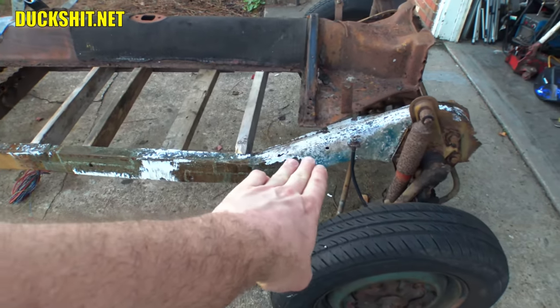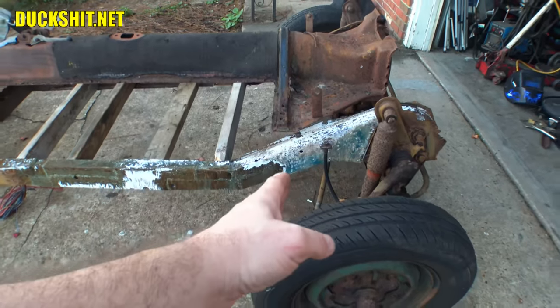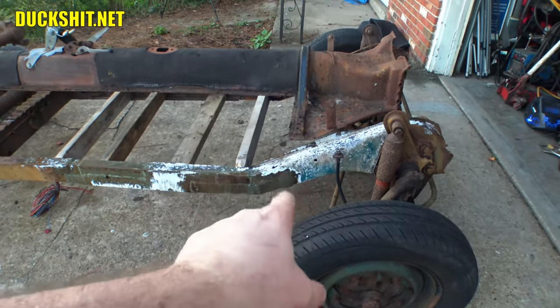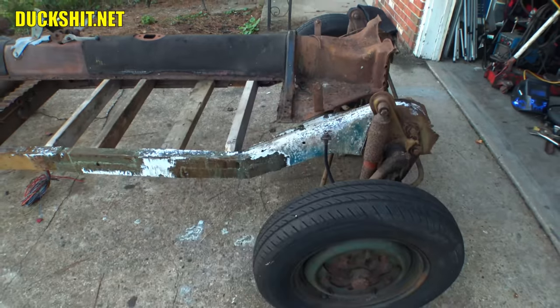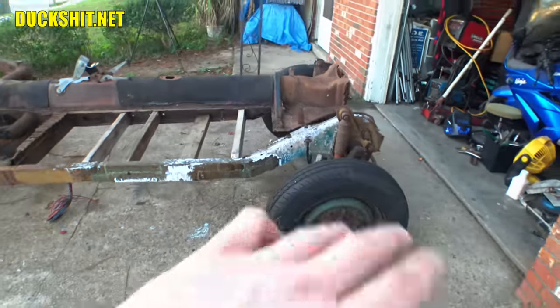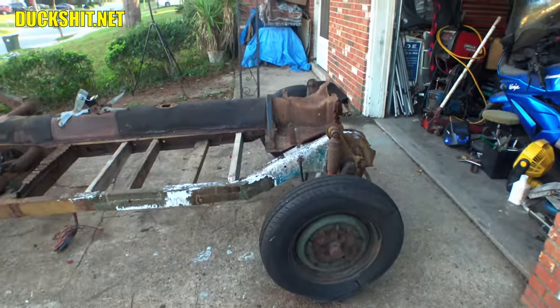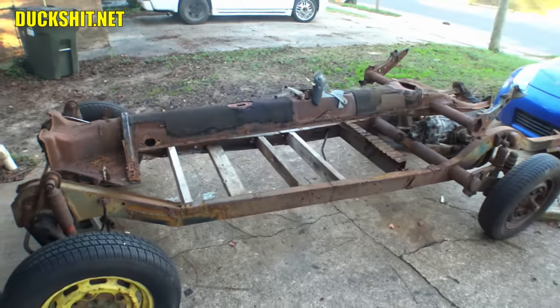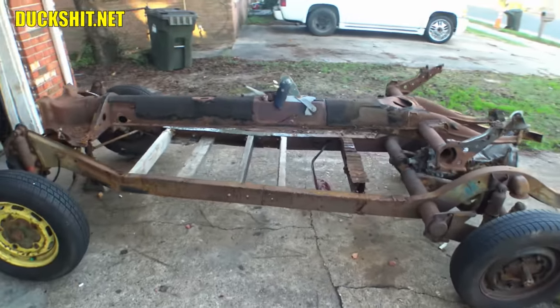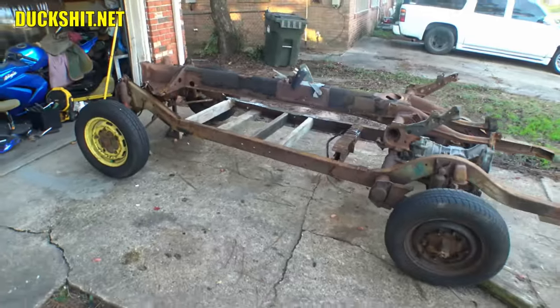So in other words, this is level and comes to here, and perhaps a 90-degree angle. I don't like the idea of a 90 because it's going to create stress at that corner. So I might just slope it up at a steeper angle than what you're looking at there. Anyway, I've got a lot of ideas to play with on this. But this should give you an idea as to what I'm looking at as far as the length of the floor pan is concerned and how identical the Beetle is to the bus.